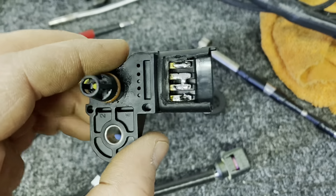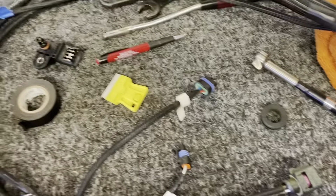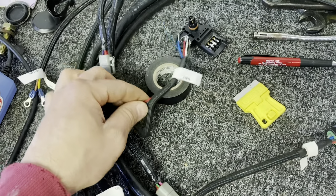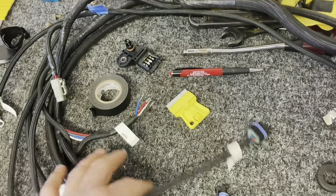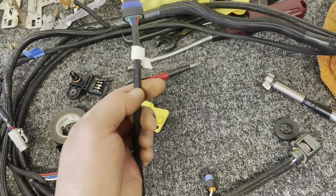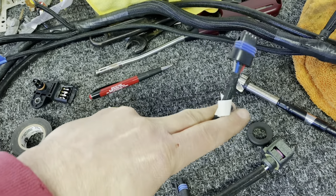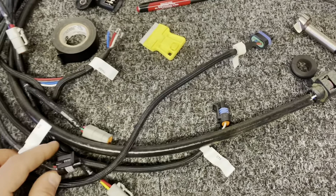I've got this thing here which I had to solder on, but I only did that temporarily just to get the car started up. So now what I've got to do is go through and shorten a lot of these wires — they're way too long. I'm going to shorten them, cut the wires, re-solder. Like this one here, I'll just cut it here, shorten it and then solder it inside. That way it looks a lot cleaner in the engine bay. So I had to take it out anyway.